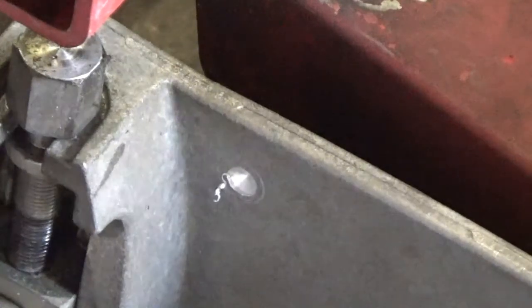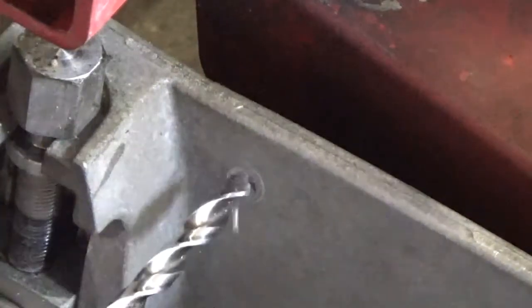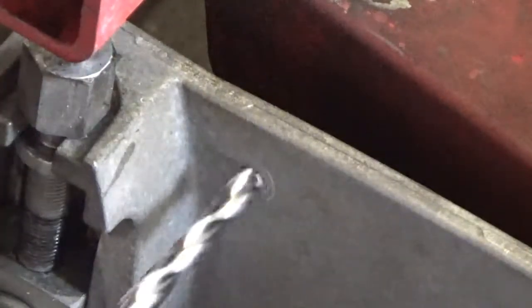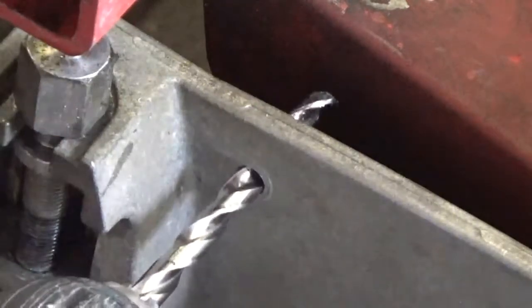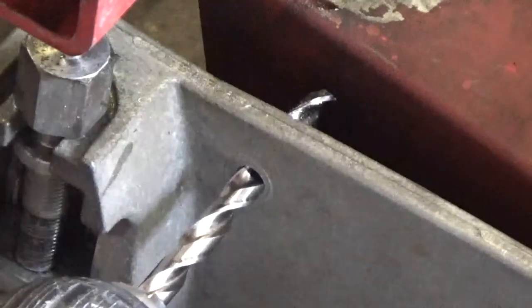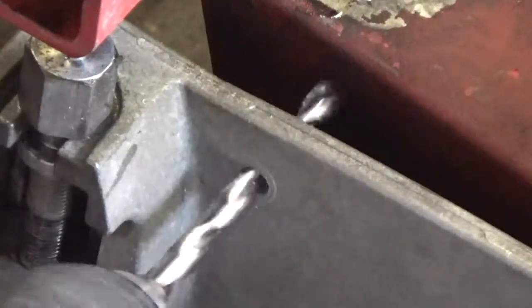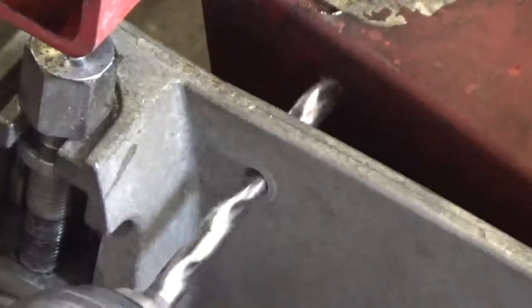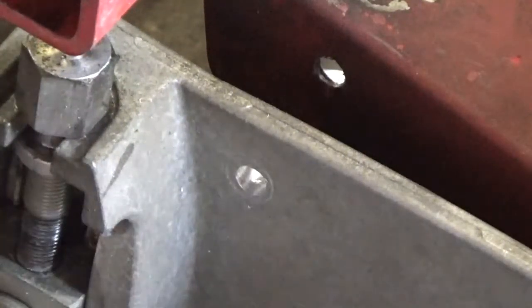I picked a nice spot on the front reel to put my side bolts in to support the reel cover. This Toro mower actually has a little bit of a circle outline - you can probably see where I started to drill, there's a little bit of an outline there - it's a perfect place to drill. I'm going to drill it through. Obviously this can be done on a bench. Holding the drill as straight as possible, I'm going to drill into the reel cover after I locate it. Now I'm going to resize it to five sixteenths.